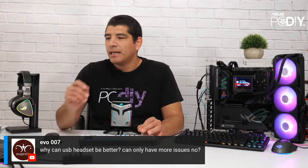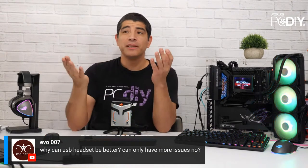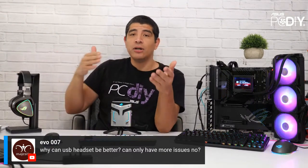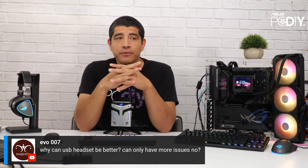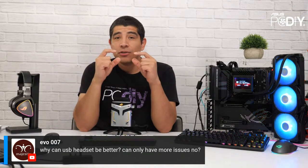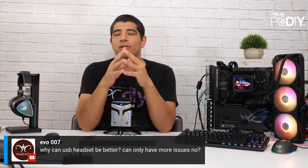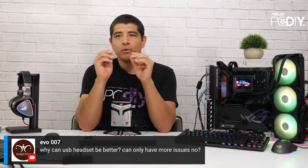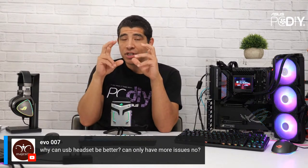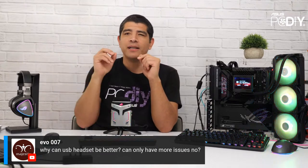Question right here is saying, why can a USB headset be better? So it actually really varies. The benefit of something like the USB headsets, like the ROG Delta or the ROG Strix Fusion 2 500 that we talked about last week, is that generally those will usually have some form of DAC and amp built into the headset. And so one key benefit is that the audio quality can be more tuned specifically for the driver in relation to that sound chip or sound card, because it's built in as part of the actual headset. That's if it's done well.